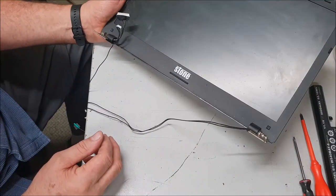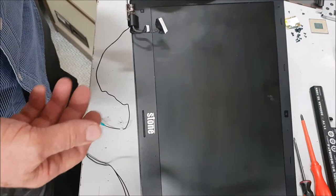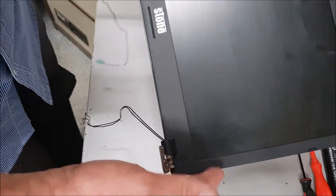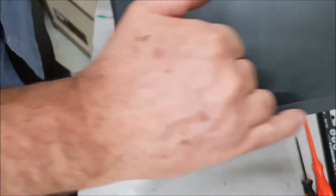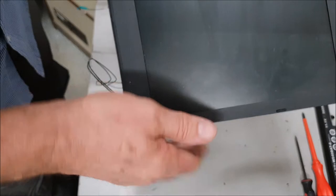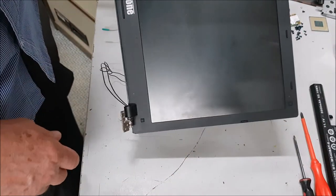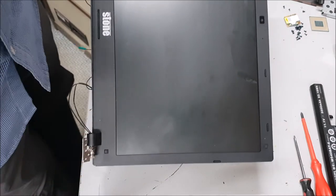This is not a tutorial on how to fix — this is actually a tutorial on how to wreck your laptop! It's annihilated. It's just showing you an insight on these Stone laptops, maybe keyboards, and how to get the screen. If you wanted to change just the screen, you'd leave all this intact, undo the little screws under the rubber mounts, take it off, undo the screws — there are usually bezels around the outside — and re-change the screen. If you'd like to see that, just leave a message in the description down below, and I'll do it for you. Thanks very much for watching, take care.